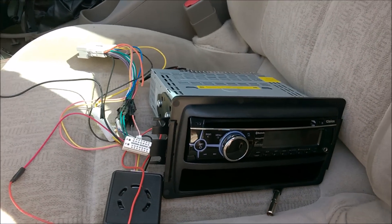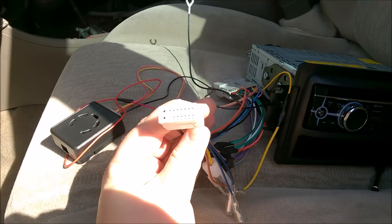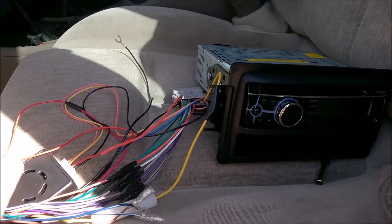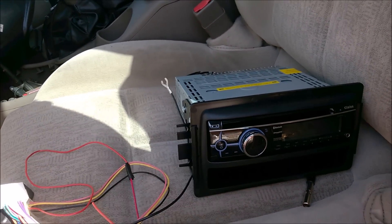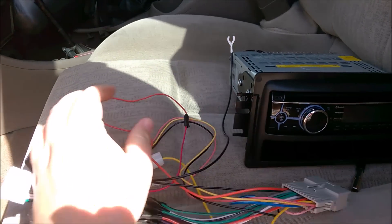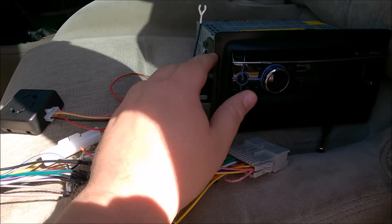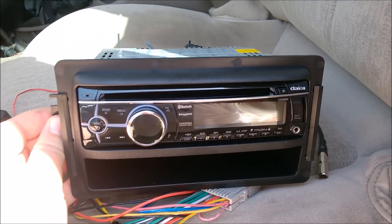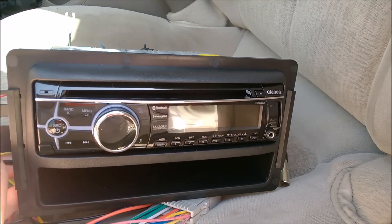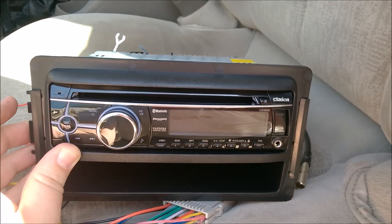Here's the radio and the wiring harness. The wiring harness is separate — this is a Metra unit. I'll include a link for it in the description; bought it off Amazon, it's just a few bucks. I specifically got one that retains the chimes, since I believe this goes through the radio for the chimes. The head unit is a Clarion — I chose it because it was one of the cheaper units of a brand I recognized that did Bluetooth. I don't talk on my phone in the car but I listen to a lot of audiobooks.